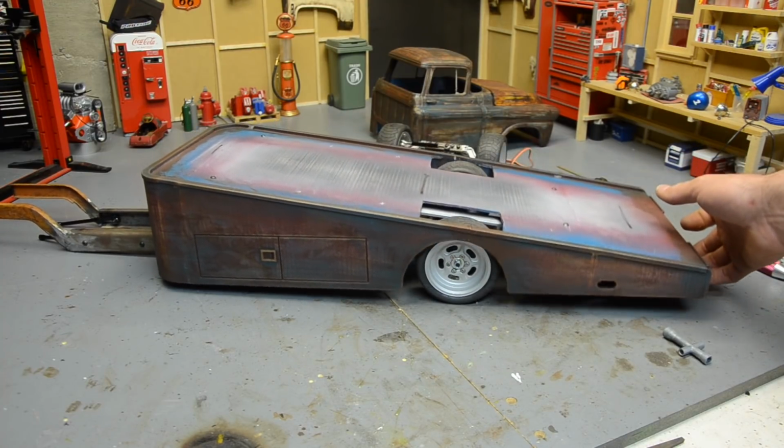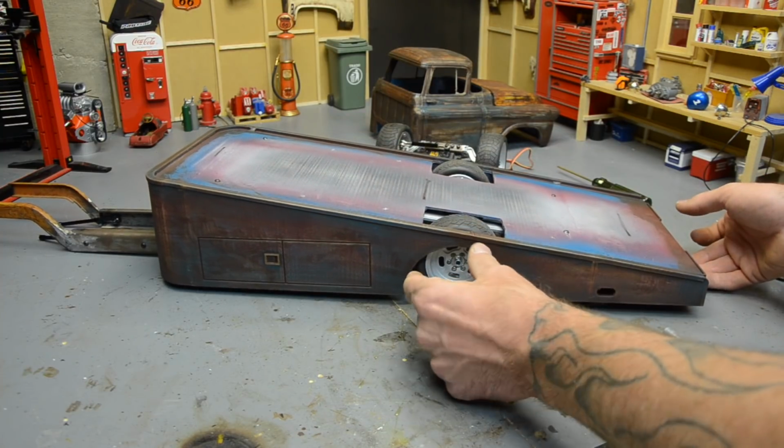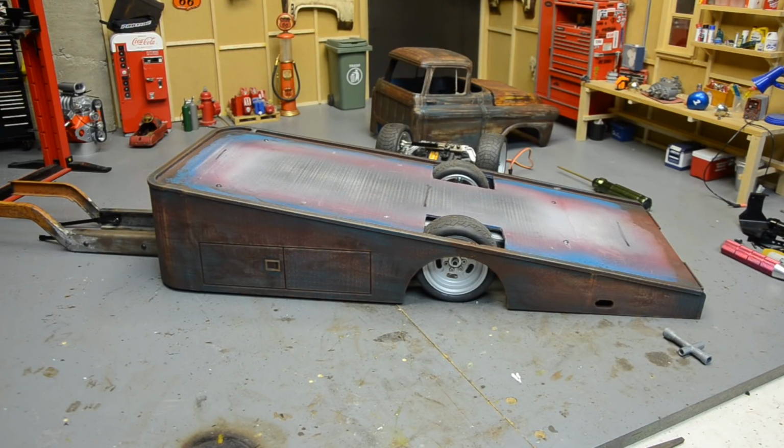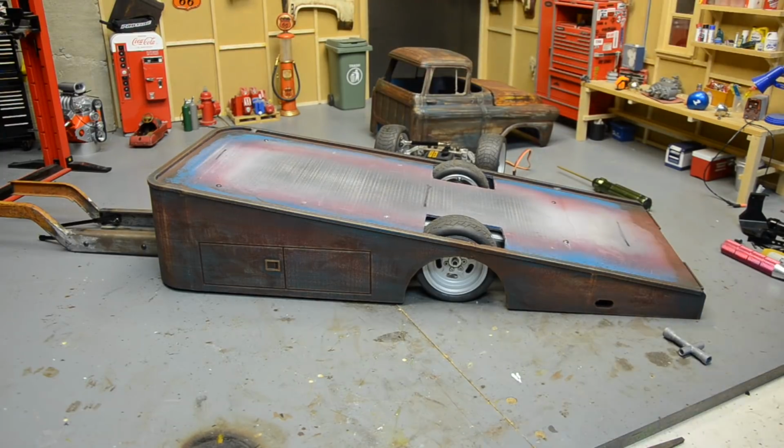See, we've got a little bit of an offset. The tire moves back and then forward and then back forward. But I think it's going to be all right. I'm counting on spacing out the front axle with the cantilever mounts. So right now the front axle is about 4 millimeters too far to the rear, and I'm counting on putting in a shock mount or a rod end in that link suspension up here. You see I've got the link still hanging out there. I've got the front axle off, but that's going to be our cantilever mount.